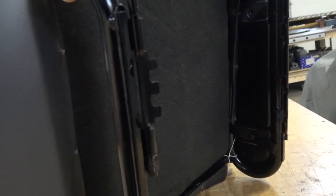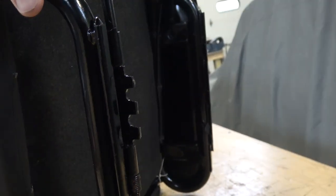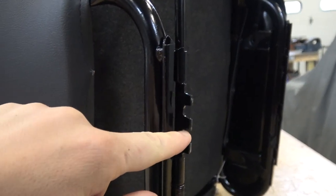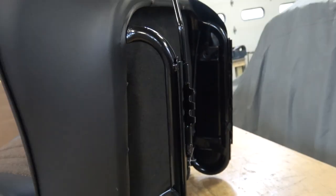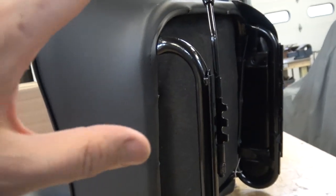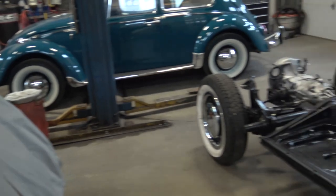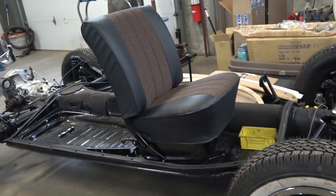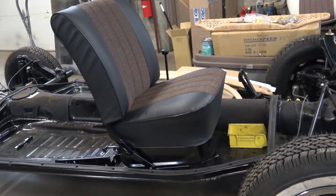That's the quick tip for today. If you guys have any questions or want to comment below, definitely open to that. If anybody's got other suggestions, we're open to hear it. Just open these up a little bit more and it should be able to go around the teeth. Definitely want to do this before your seats are painted or upholstered. If you have the body off, it's a great time to test the seat back and forth on the rail prior to things being put back together.